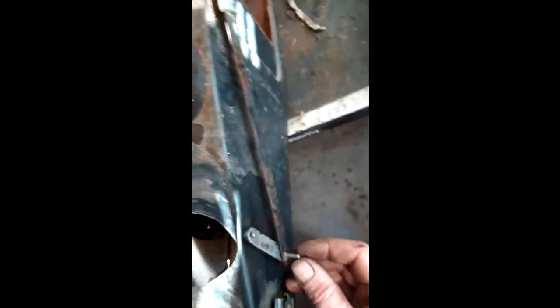But what happens on this actuating rod here, as you can see, it actually moves this flap, or that lever. This one can be moved independently on another Bowden cable, like so. And you can see that it has no effect on that. So that only operates when you operate the cable for this. Hence moving that.